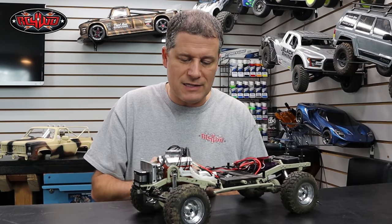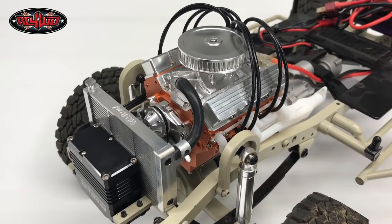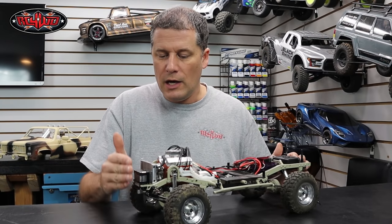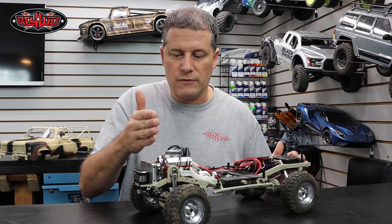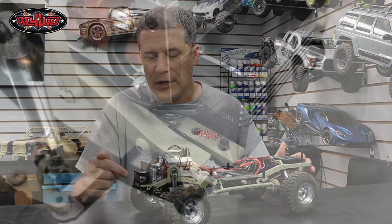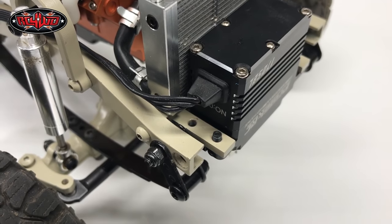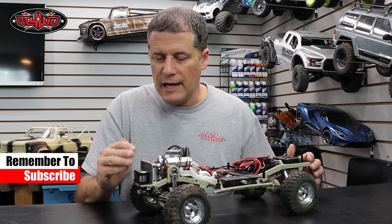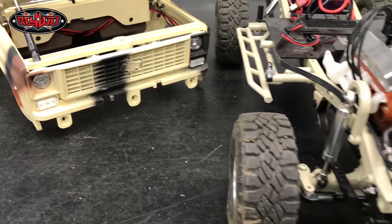After the headers were installed, I moved on to getting it back into the vehicle, and that's when I noticed a couple of things to look out for. One thing is the servo location — I had to flip the servo mount around to place the servo up front to give some clearance for the radiator and the pulley assembly. With the servo back where it was, it was a little too close. It is going to need a little modification where the shackle meets the frame since the screw kind of hits that servo mount. Also, I'm not going to be able to use my custom front bumper — I'll have to find another option, but with the Blazer body the stock bumper mounts on the front of the hard body, so it's not such a big deal.